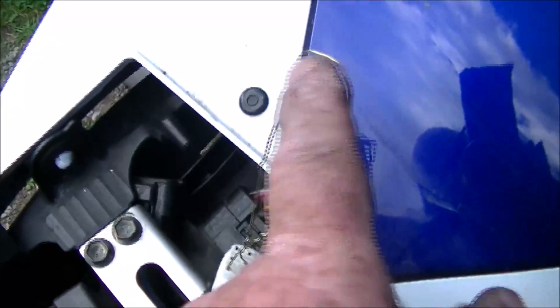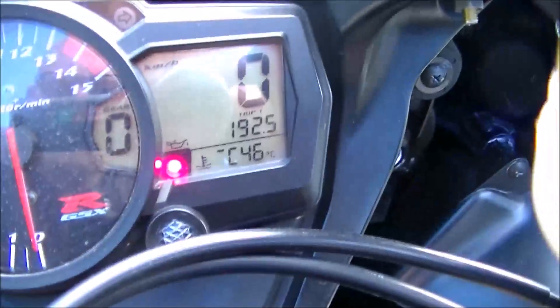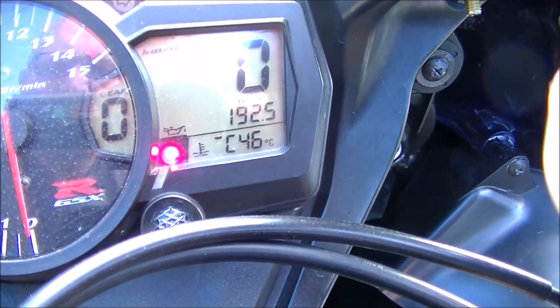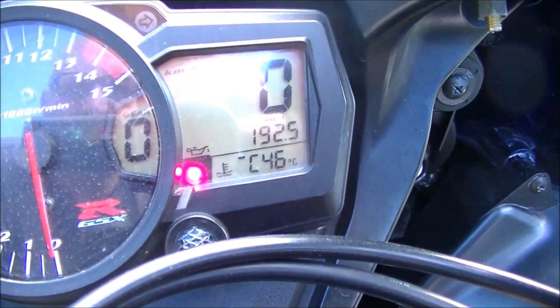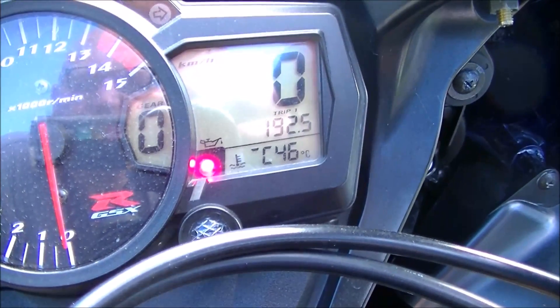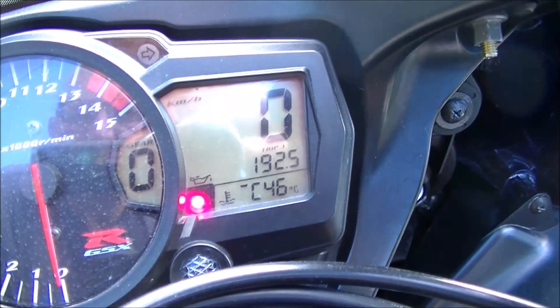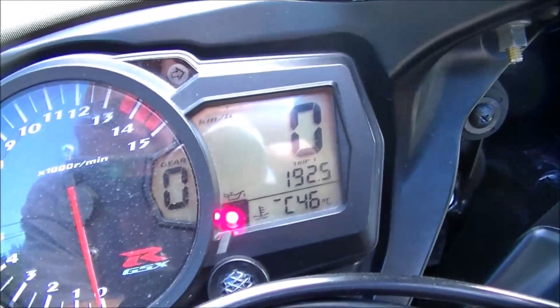You can see it here connecting those two wires. Now up here we have a C46, which I'm going to bet is that exhaust flapper valve. So I'm going to clear it and see if removing it has fixed the issue. If so, it should never set again because there's not going to be any flapper valve on it when we're done.